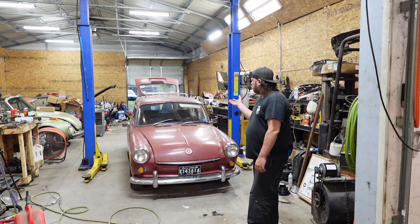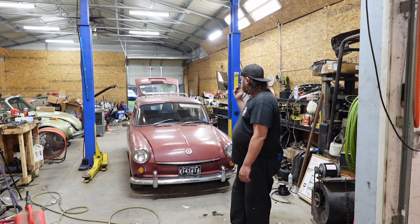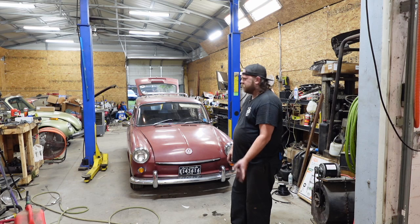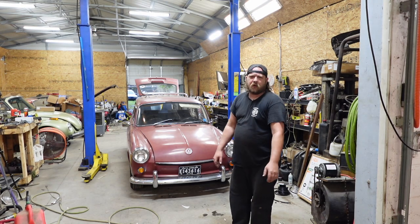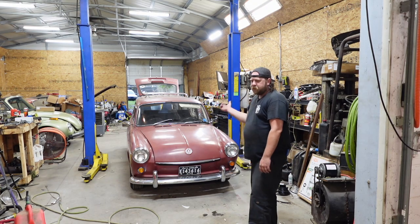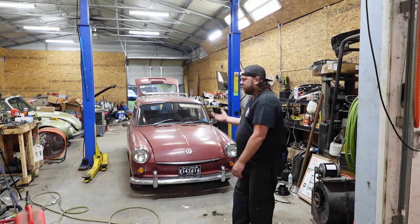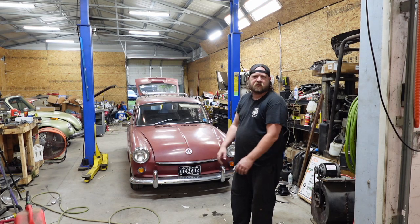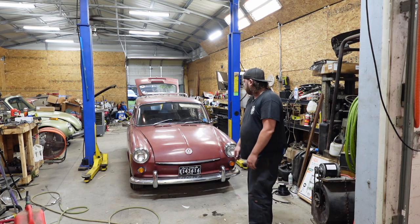The other thing we were supposed to do, I already fixed, because it was installation error on someone else's end. The car wasn't charging. The voltage regulator got put in wrong. Switched two wires, it charges. So that's done. Sorry, it got here, I looked at it, and I was like, oh, there you go. Because we did put a new generator on this car, and with new parts, they do crap out. But I'm like, really? Realistically, two months of driving, if you add up hours, I didn't see it failing that soon.